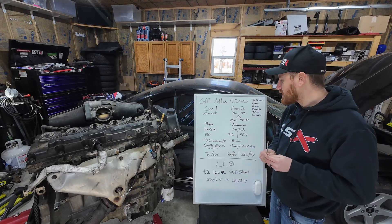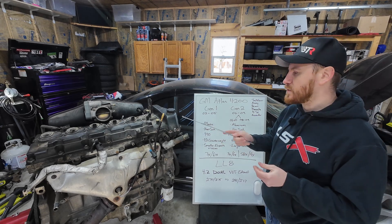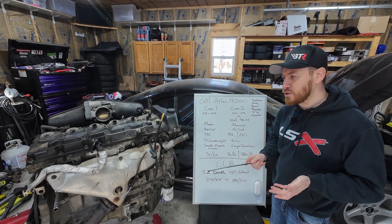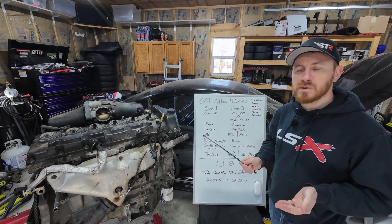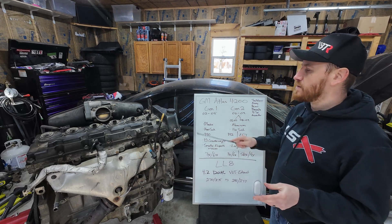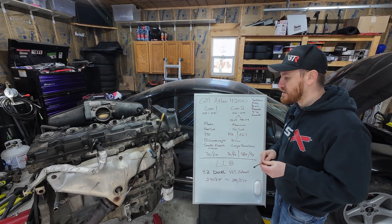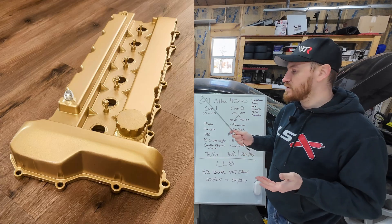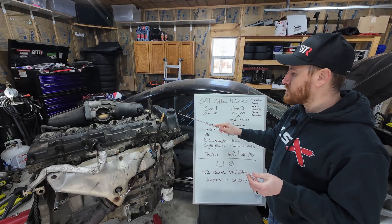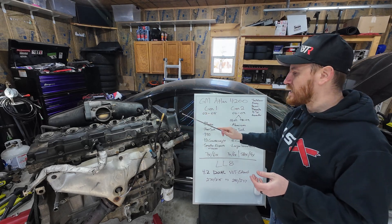One of the obvious ways to tell between a Gen 1 and Gen 2 starts right here with the valve cover. This Gen 1 has a plastic valve cover; when they moved to the 2006 motors they went to an aluminum valve cover. The nice thing about aluminum is you can weld it, so if you wanted to add any bungs when going to a turbo setup. Additionally, one of the highest points on this motor is the oil fill cap, and a lot of folks will shave those. Atlas Industries is now offering a service where you can purchase a valve cover with it already shaved — they'll move it over and also take a bit of height off the front.